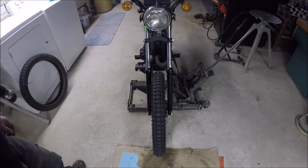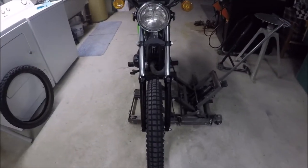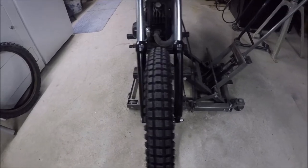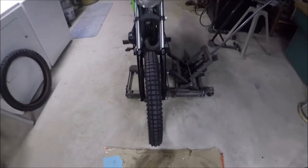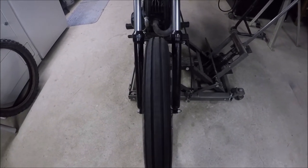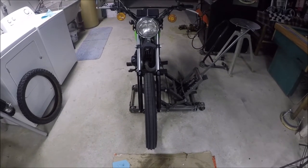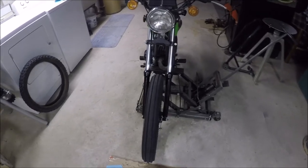So that's the front tire — worst front tire change ever. I was looking at this thing like something just doesn't look right. There's more space on the right side than there is on the left. I've got this fork backwards. The left fork you can't put backwards — it has that brace that holds the drum plate. This side I have backwards, that's why the wheel looks crooked and why it looks uneven. Let's see if I can fix that. That certainly looks better. Not perfect, but a lot better. Still part of the worst tire change ever.